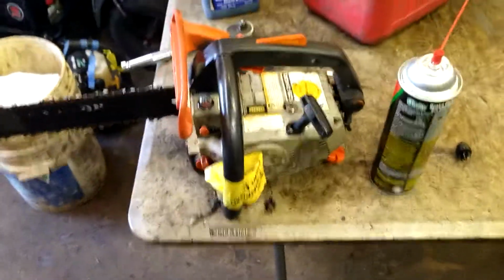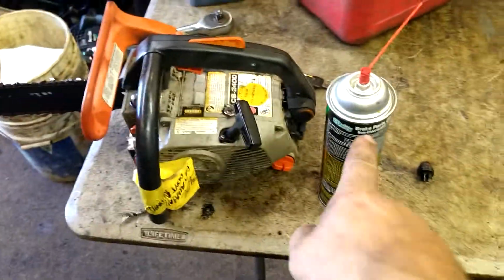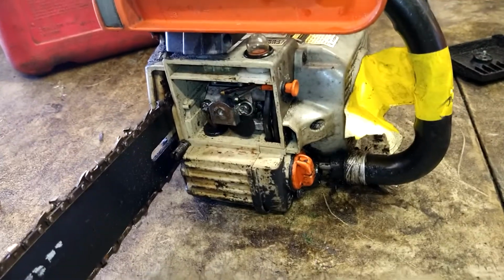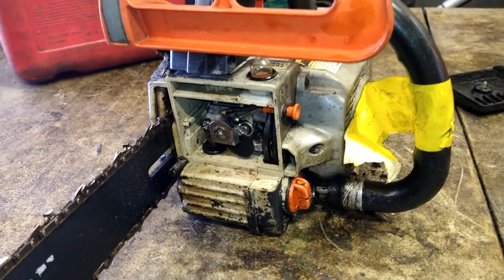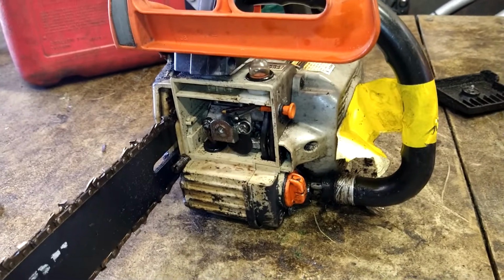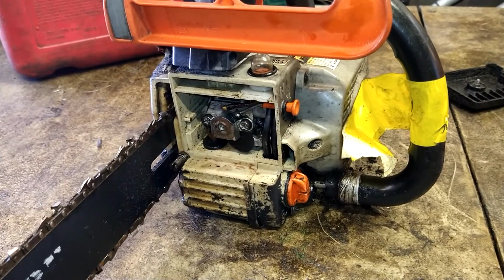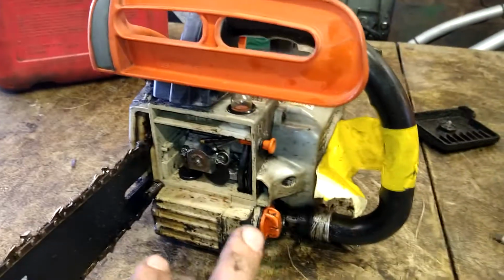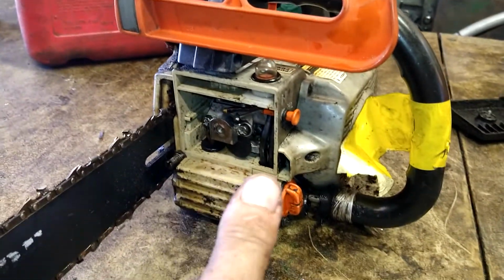Alright, so it didn't want to fire up. I sprayed a little carb cleaner right into the mouth of the carburetor, and it fired up, shut right back off. So I'm going to be ordering a carburetor set that you'll see in the description below, and I'll do a whole other video on doing that. But for you guys that just need the primer ball replaced, you're ready to go.